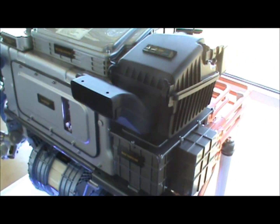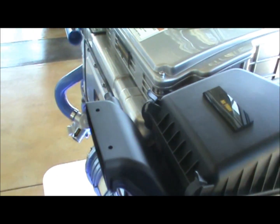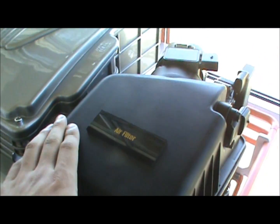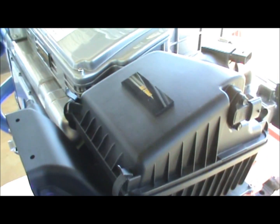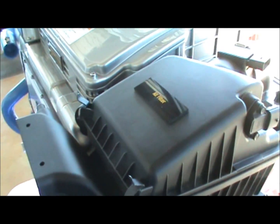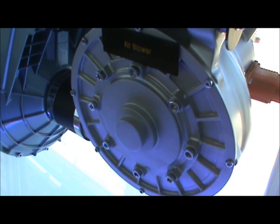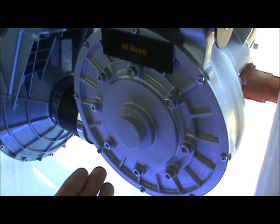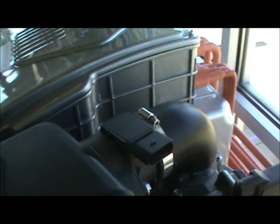Now let's talk about the air processing system. The fuel cell stack pulls air from the environment through this inlet, and it goes through the air filter. The air filter removes any carbon impurities going through the stack, which is a key component in preserving the fuel cell lifetime. Below here is an air blower, which supplies air to the fuel cell stack. The more power demanded by the driver, the harder and louder the blower gets — at high power it can be much, much louder.